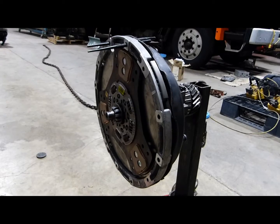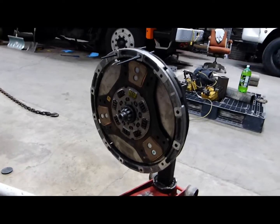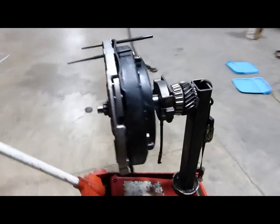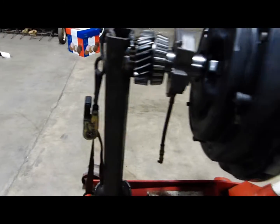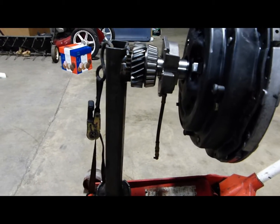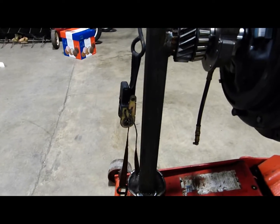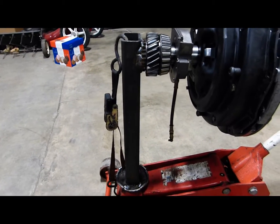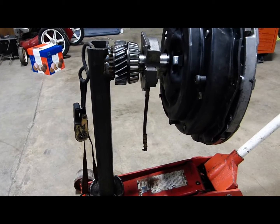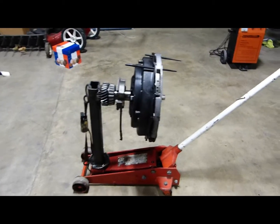Let's hang the clutch. Here's the assembled clutch — it's about a hundred and fifty pounds worth of clutch and more than I want to lift into place. There was too much of a lean on the upright post, so I've modified it with a strap to give some pullback and help keep it more upright. It doesn't have to be perfectly upright, just good enough to get some bolts started.